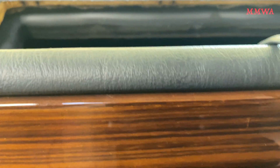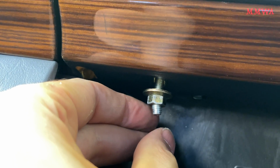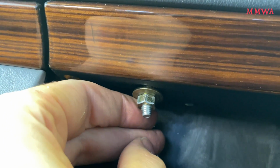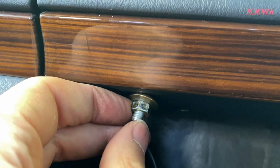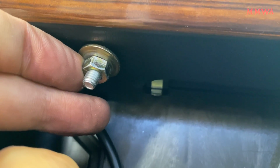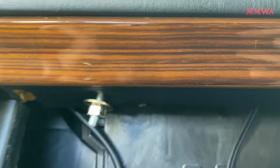These are little locking tabs that are supposed to stop those square bolts from rotating, but you can see that one on the left is bent like a banana. I've no idea how that would have happened. Someone has been ridiculously rough with this car in the past. Unless it came from the factory like that, that would be shocking for an MB technician to install something like that. Why would you even need to bend it like that? That's absurd. So I need to find another one of these bolts before I put it back together.